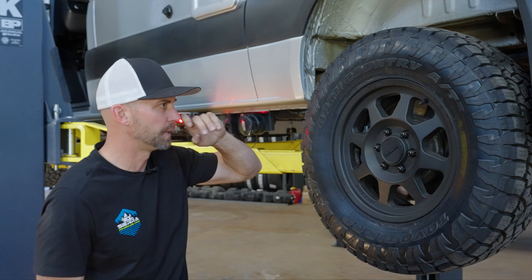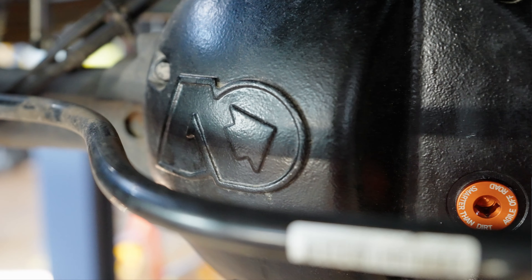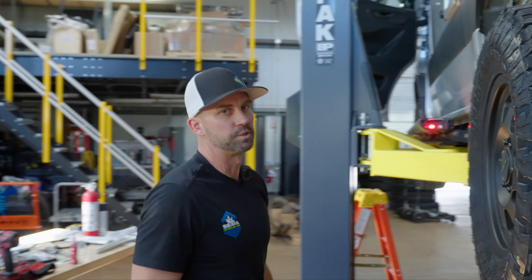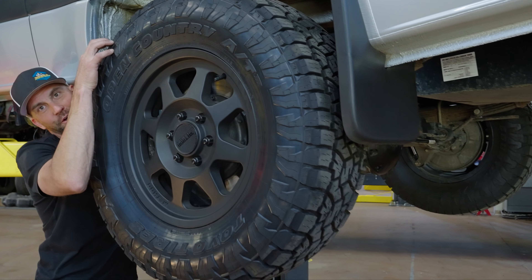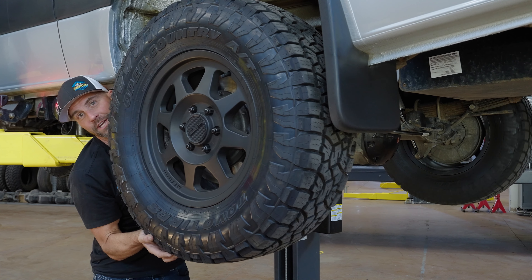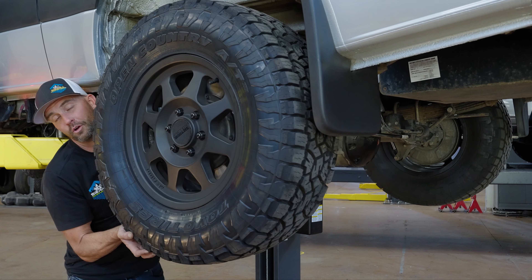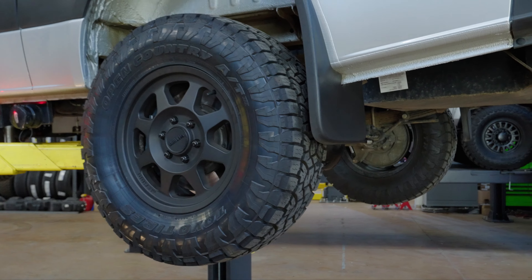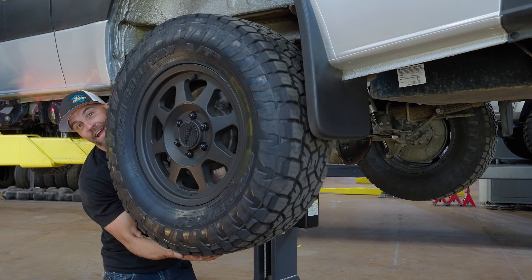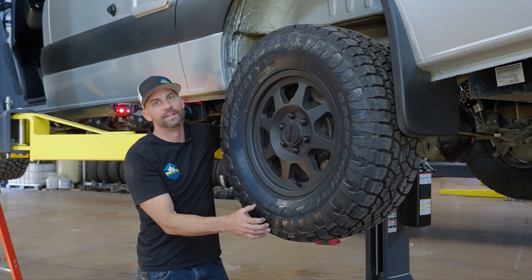The other upgrade that this van has that we wanted to point out is the airlocker. You'll see here there's a new differential cover — it's got the Agile logo of course — and inside it's got a new ring and pinion and a new carrier that has an airlocker. The best way to explain what's happening here: you're driving your van off-road and the drive shaft is spinning. Let's say this tire finds traction — look what's happening to the other tire. It's spinning freely, like spinning in a mud puddle or snow, maybe hanging in the air. Now let's lock it. This drive shaft spins, this tire still has traction — now look, I can't even hold it. Both tires are spinning together. This tire would find traction and roll right out. You're getting back to camp that night instead of calling for help.